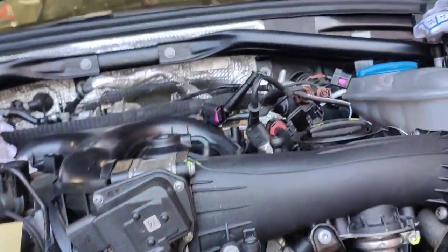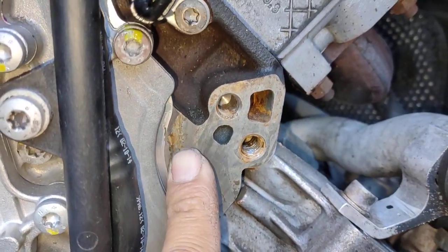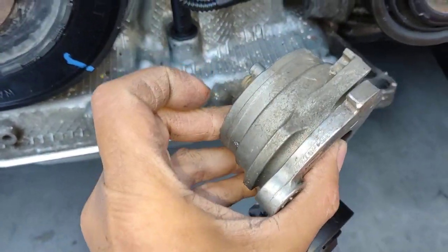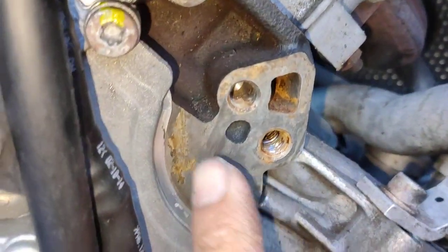Alright, it's all ready now. Pretty much everything is assembled here. But the only thing I was waiting on is the actual washer that goes there — there's a washer that goes here. Somebody had removed this tensioner. It should be a washer that goes between the tensioner and the block.